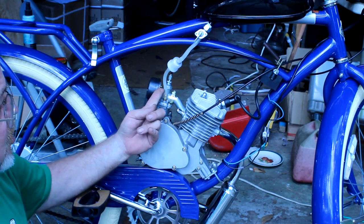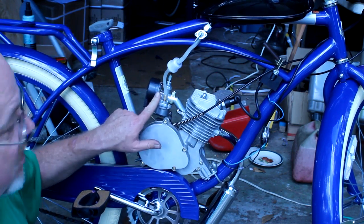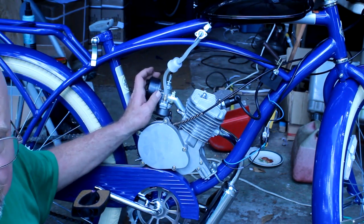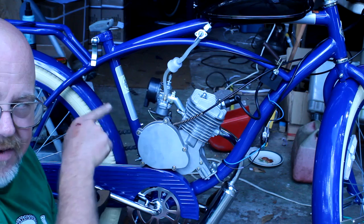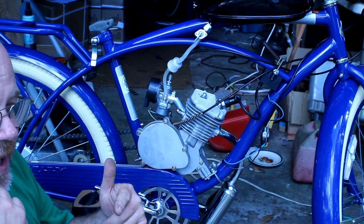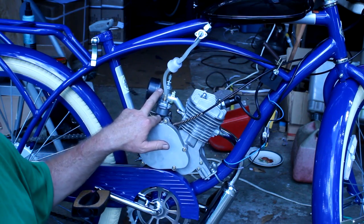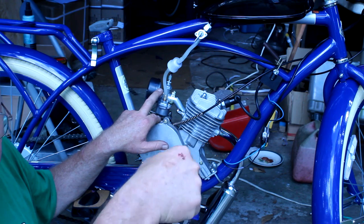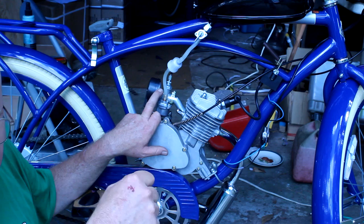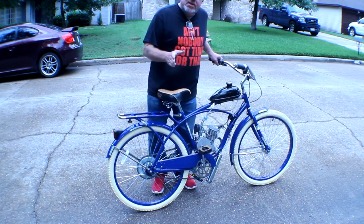Here is your choke. On this particular carburetor there's no lever or cable — just the lever on the carburetor itself. Up is the choke position, which blocks the air inlet and forces the motor to suck more gasoline. To start: have gas in it, fuel turned on, move the choke lever up, then pedal the bike and release the clutch — that will start the engine turning. You should hear a pop pop pop, and then the motor will begin to run. At that point, immediately push the choke down into the run position and feather your throttle. When you first start the motor it's going to be tight and won't run perfectly — give it a little while and slowly coax it up.